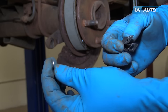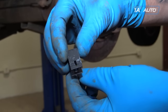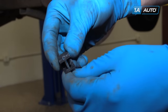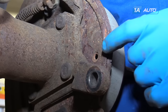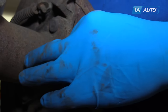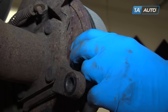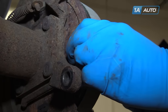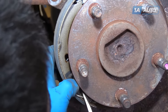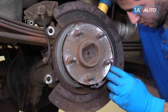We're going to install these retaining pins into the back of the backing plate. Since it's going to be a little difficult for you to see once it's in the vehicle, you're going to set these over the pin. Press down on the end of the spring clip and rotate it so the pin locks into that groove. There's a small hole in the back of the backing plate as well as on the opposite side, where we'll install our retaining pin through there and through the corresponding hole in our brake shoe. Get your finger to hold that in place, send the spring clip in, and lock it down onto the other side. Repeat this step on the opposite side.